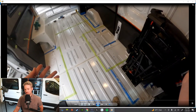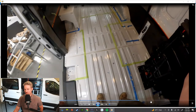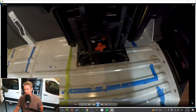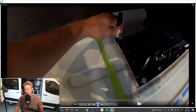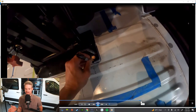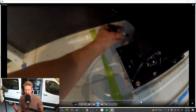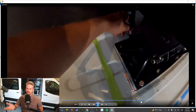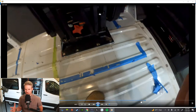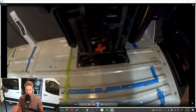Look how much space you get by just having that flip and fold seat — it's really cool. The next step after you've got the seat temporarily mounted is you're going to want to go through and trace around the seat. This is only going to be for reference when you go to put the floor system in, or if you need a visual reference of exactly where that location is — say you're running an electrical wire under the floor, you'll know where the seat is.